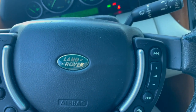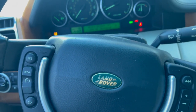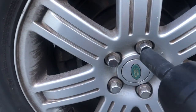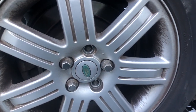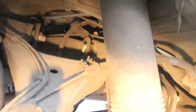I'm going to be very short with everything and try to give you details as best I can. We already got our vehicle safely jacked up with a jack, jack stands, as well as some wheel chocks. We're going to go ahead and take off our tire — it's going to be a 23mm. Here's our rear strut we're going to be replacing. At the bottom you have one fastener connecting it to the knuckle, and then it goes up into the trunk area.